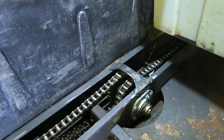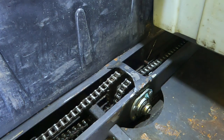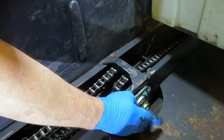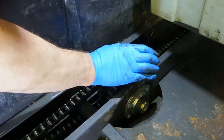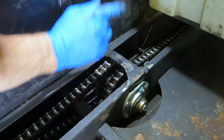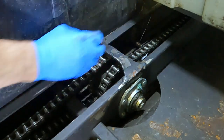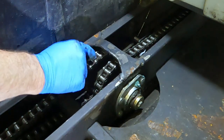It's the outside bearing. It's probably a good thing I kind of wondered about that bearing. This year I lost the very front bearing on this side, and I lost the second bearing back too. I think what happens is: on the very front, both the inside and outside bearing blew out, so that whole shaft could move back and forth. That shaft moving back and forth yanking on the chain pulled on the next shaft back and blew out the outside bearing on that one. With that bearing gone, it could jiggle the next one back and forth and compromise that bearing — and that's exactly what it's done.